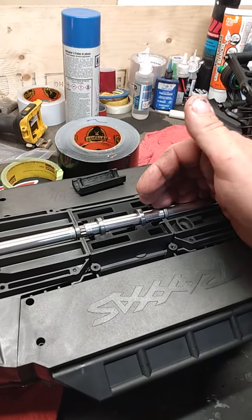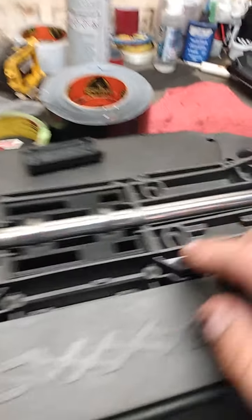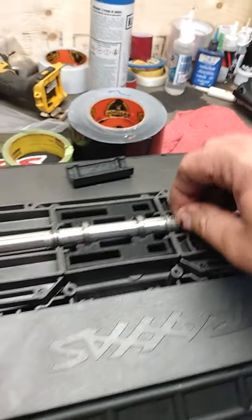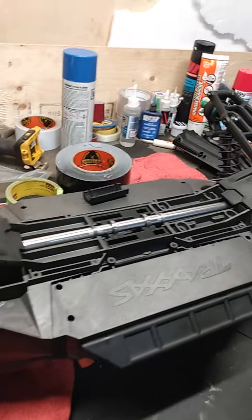With the solid shaft, you'll probably bend it here and here. Third way — a gentleman in the states cut his shaft into three pieces and let it just float around in the center. That's probably the best. But I don't like the fact of it just flopping around. At some point you're going to wear your bulkheads and your chassis with this shaft just slamming around in here.